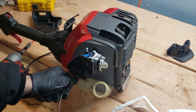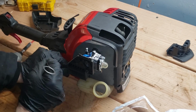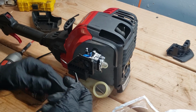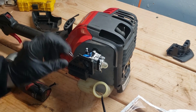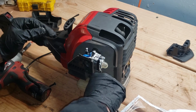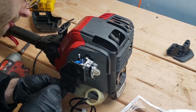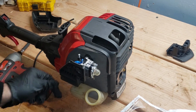Where your fuel line enters, you're gonna insert this fishing line and loop it around to the filler neck of your tank, okay? Then we're gonna take the fuel line, put it through this hook here, just insert it. And that's what's gonna allow us to nicely fish this thing through, hopefully, in a perfect world. Nope, I didn't think it would be this easy.